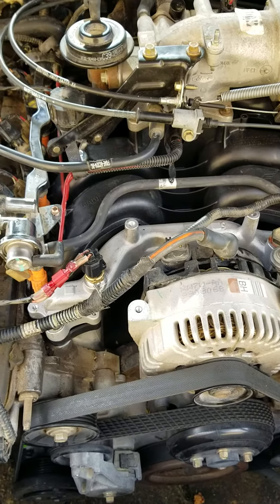Because of that, the coolant temperature sensor — the original one — was grounding on the metal here, and every time it would ground on the metal we would get the temperature gauge spiking full hot all the time. You unplug that sensor and it goes down to cold obviously, because there's nothing there.